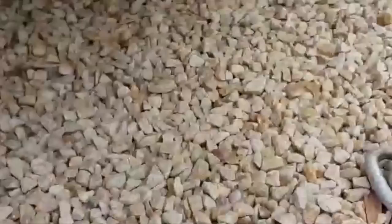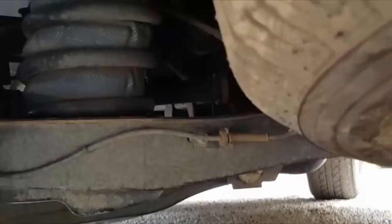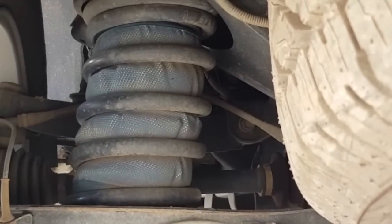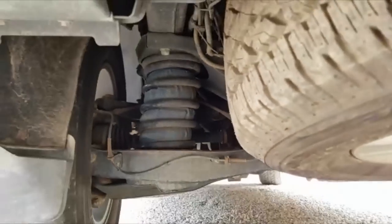This one's not as specific to the caravan but to your car — I put airbags in between the coils. You inflate them to 50–60 PSI, whatever you need, to level the back of your car out with the extra weight on it.